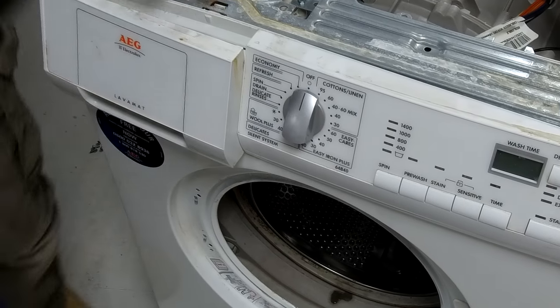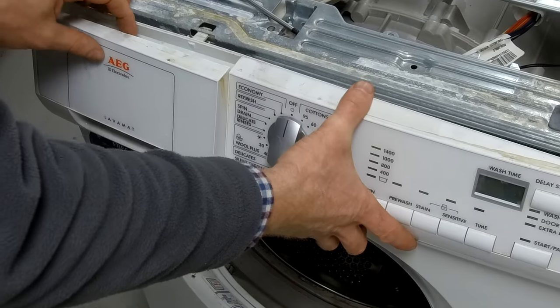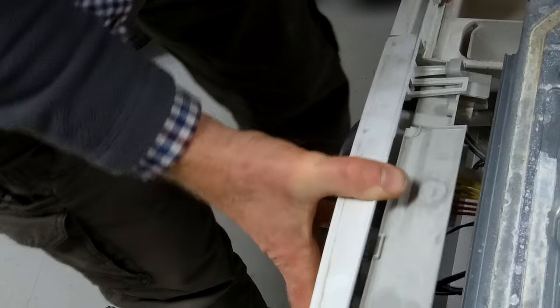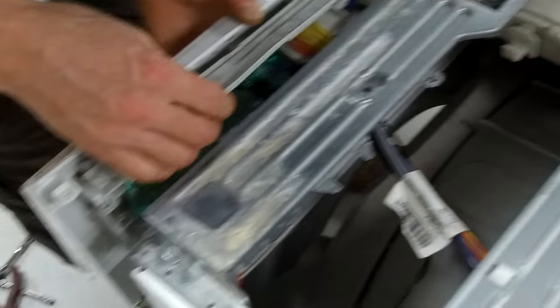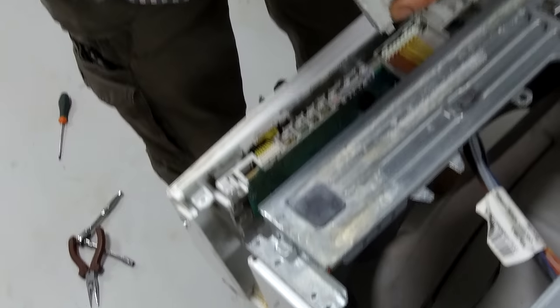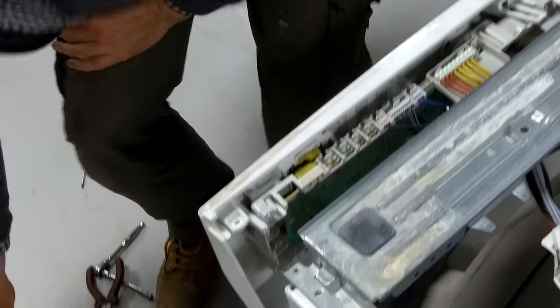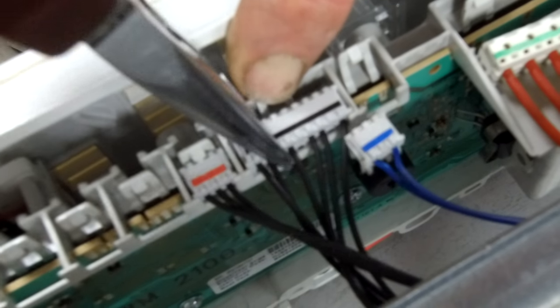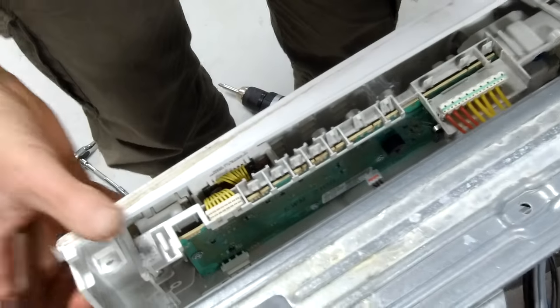I've got these two little screws out — they're just hidden under the tray, two of them. They're a little stainless steel looking self-tapper, two of those, both the same, hidden under the tray. Not sure if that allows me to get this front panel off. That clip's definitely doing something there. Something's coming now — we're on the wiring now. We've got a little panel with side clips — that exposes these. So remember where they're going: green, blue, black. They just pull up — you've got to release that clip. Not AEG trained.